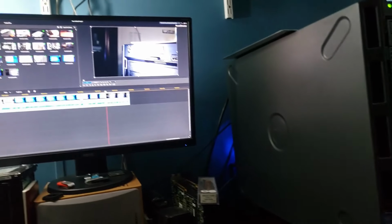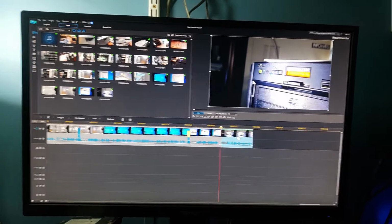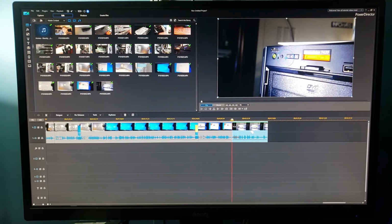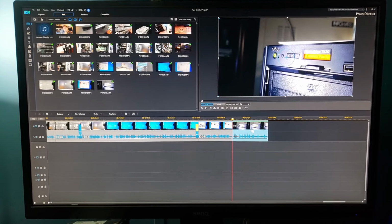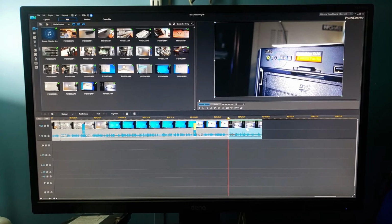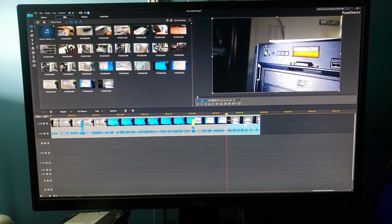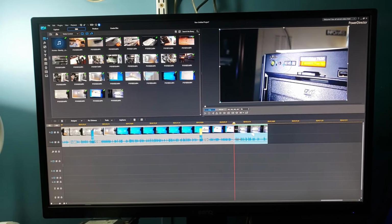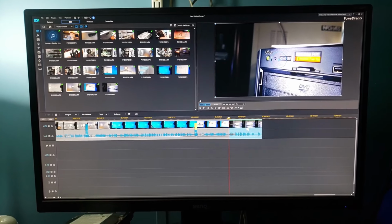The Radeon R9 270, CyberLink PowerDirector, yeah, that's what it's called, actually has GPU acceleration for encoding with this video card, so that's nice. I don't really want to use the 980 in here because I like that card for testing purposes, if nothing else. Since this is a video editing machine, that card's capabilities would probably get wasted. But now that I know this can take advantage of GPU rendering, I probably will go ahead and try the 980 in it and see how much of a boost in rendering speed that gives me.